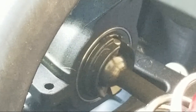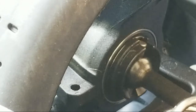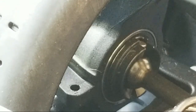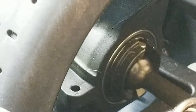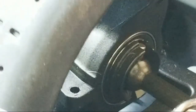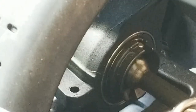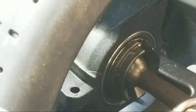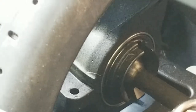Okay? And there's obviously the dog bone and that cup. So do you see how you're getting a reveal of the bearing? So there's actually this slop in that. It's not just the slop of the pin, because the actual plastic has slop too, which you've got to expect, I guess. There's a certain amount of slop. That obviously just needs to be shimmed out.